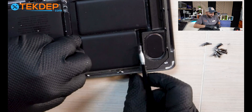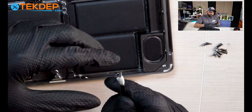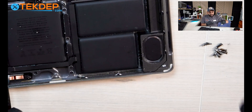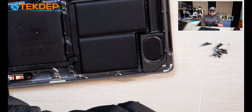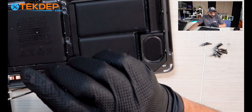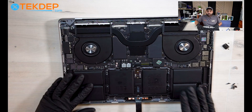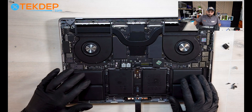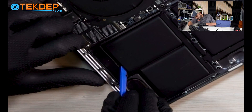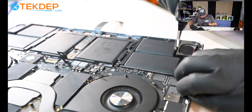I don't know why this is the case with this design, but that's fine - we know how to do it. If you want to get one of these repairs done, send it to us. We do have a mailer repair service, or if you're looking for the battery itself to replace at home, the link for tools is in the description below. We're moving on to the other side now - these two cells are almost released. We'll work on these two cells, and after that we'll need to remove the trackpad to access the remaining ones.